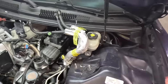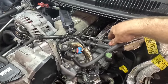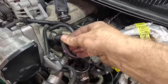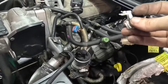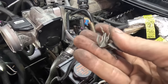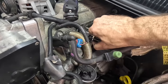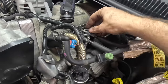Good. Let's travel back to the driver's side and get some of our other hoses connected. We have the two fuel lines right here. You can't get them backwards because they're two different sizes. We've got the evap system connector right here. And of course the little backup clips for the fuel lines. These are two different sizes, I think. That's our big one. It slips in and then just kind of clicks down over the line. There we go. Same thing with this side.